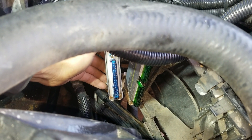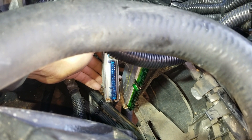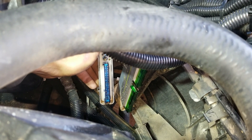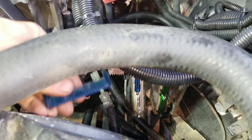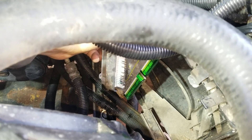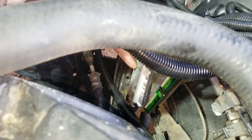Alright, so you can see the corrosion on the very bottom pins, and you can see the dirt. Not too happy about that, but it should clean up. Hopefully this will fix it. So I'm going to get these cleaned up and then let's see how it's running. I'm just getting in there with a toothbrush and some rubbing alcohol. I took the plastic piece off, and you can see the lovely green corrosion down in there.